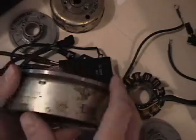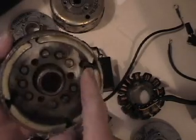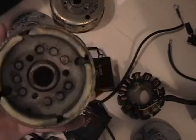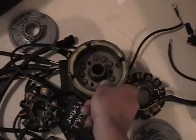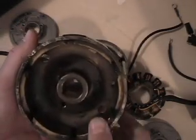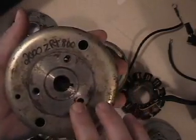There are three pickup areas — one, two, three — and you've got timing lines on here as well. Looking at the 1993 through 1999 flywheel, most of those just have four magnets inside. I've been told some 1998 models actually had six inside, but the majority of 93 through 99 have four. Now here's the 2000 to 2002 flywheel — I just left the key inside it — and it's got six magnets. You can see how much thinner these magnets are, and on the outside it has holes in it, plus the three bolt holes, key slot, and so forth.